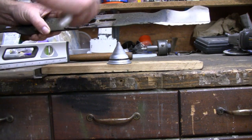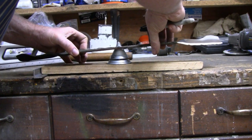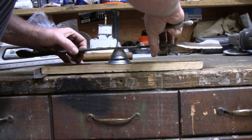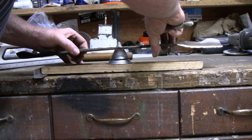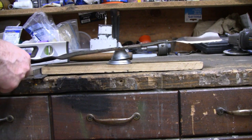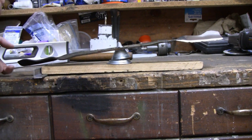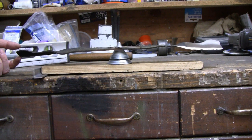It's got a blade. You stick it on the center of this thing. I lowered the camera down so you can actually see — see how close this end is to the bench and this one's up high. That means we have to take some material off of this side here. The more material you take off, the lighter it will get, and it will bring it up level. That's what you want — you want it as level as possible.